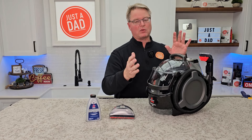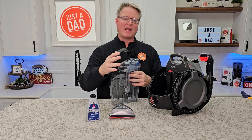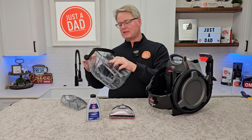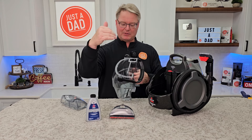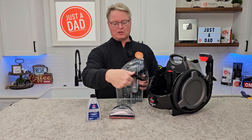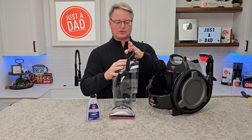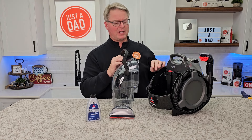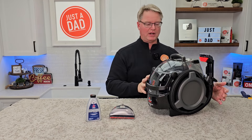Here's the dirty water tank — it's got a really large dirty water tank. You're going to lift the handle straight up. The nice thing about this dirty water tank is I can take the lid all the way off, empty everything out in the sink, get all the dirt out of there, and get in there and clean it. That's a really important feature — being able to get inside with a brush and clean it, because those things can get really dirty. With the handle all the way down, you put this back on. These ears have to go in this little area right here, then lift the handle straight up. Once in a while this red screen here will get some hair on it, so you may have to wipe that off. Then you just slide it down, put the handle down — very, very easy.